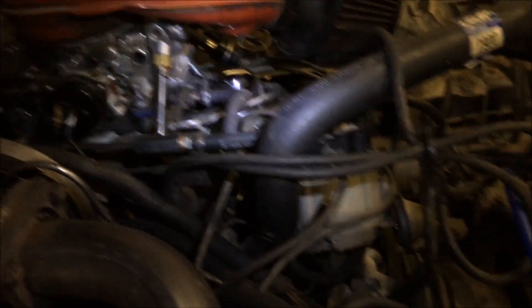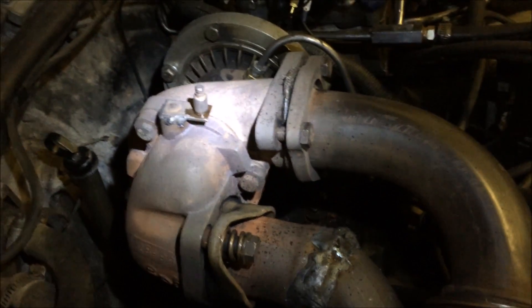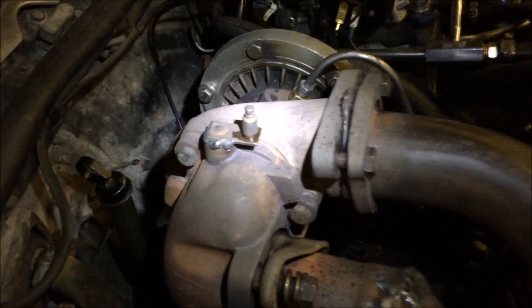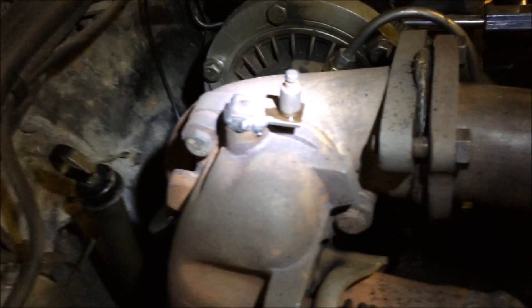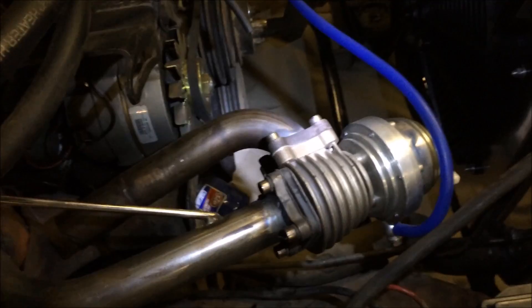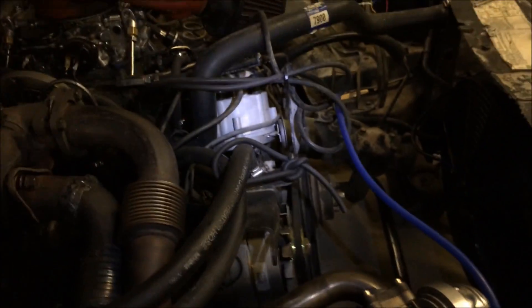There's the four-barrel carburetor. There's the exhaust section of the 1987 Buick Turbo. And as you can see, the internal wastegate valve — we welded it in place so it stays closed, therefore transforming it into an external wastegate, which reacts much better than the internal wastegate used to.